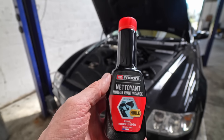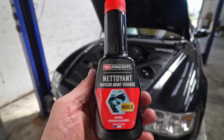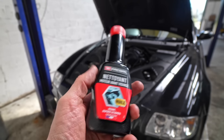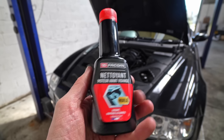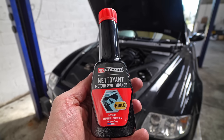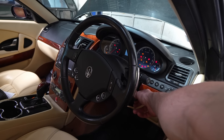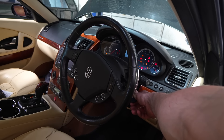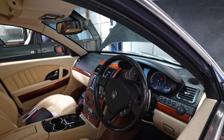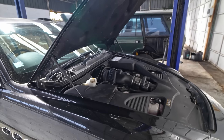The engine flush goes in the oil now. It's up to running temperature — you leave the car idle for about 15 minutes. It floats around, gets rid of gunky deposits and old crap oil, that sort of stuff. Then we'll drain the whole lot out. Now I know I can definitely drain the old oil because I can undo that sump plug. We'll leave it for 15 minutes.